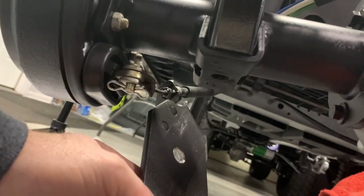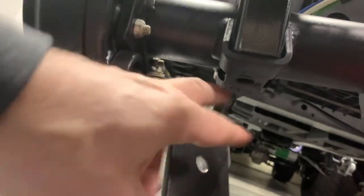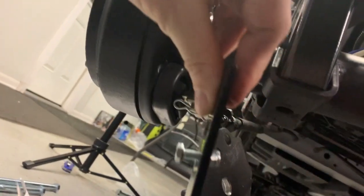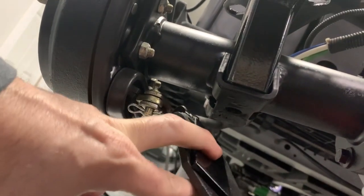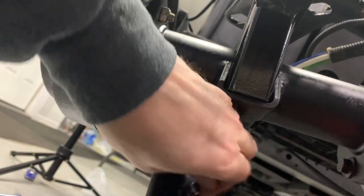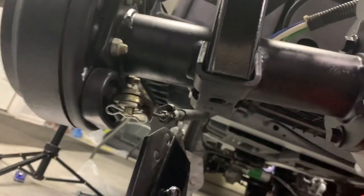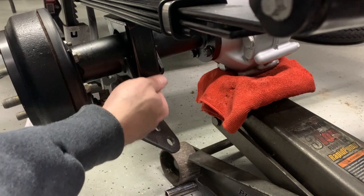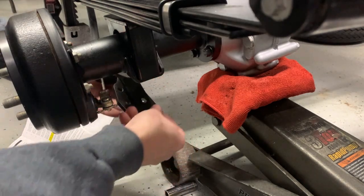So in my last video I talked about having to hog out the bolt a little bit here — that's what I was talking about when I put it up against that HD spring; it didn't fit and we were hitting right up against there. So now there is no locator, but the kit does come with this locator plate. I'll just have to tighten that bolt down — it'll go here and it'll locate the axle. I'm going to assume we're going to put this down — this would be too long, that would hit, so this goes down that way.